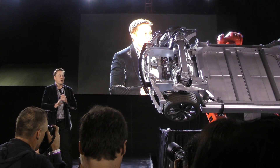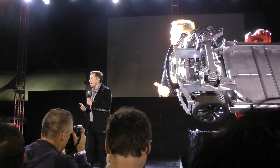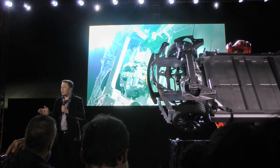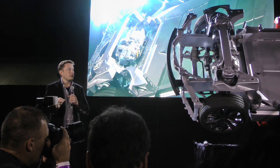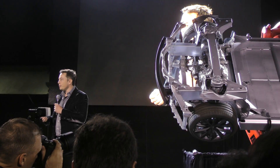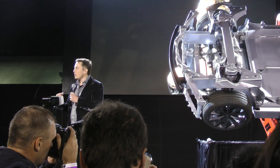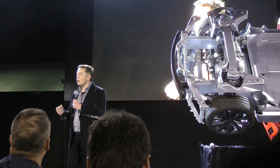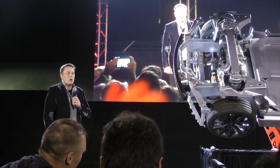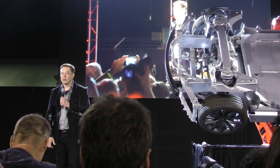As you probably know, with all all-wheel drive systems out there, you get less mileage — it's less efficient. But in the case of the Model S, because we can have two drive units and shift the power from front to rear, constantly being at the optimal efficiency point for each motor, we're actually able to overcome the penalty of the increased mass. Any given motor has a power versus efficiency curve. The default behavior will prioritize traction control and road holding first, then efficiency, and then as soon as you punch the accelerator it goes to max power. Literally everything improves about the car with dual motor — there's no technical drawback.